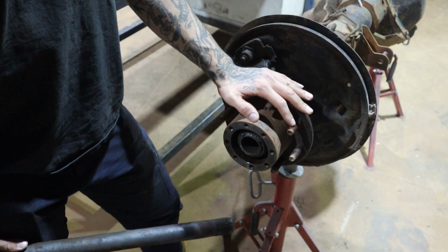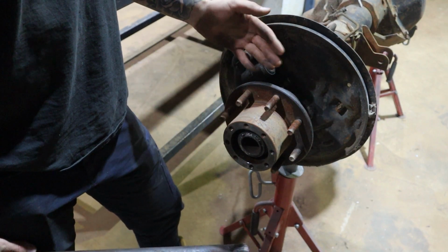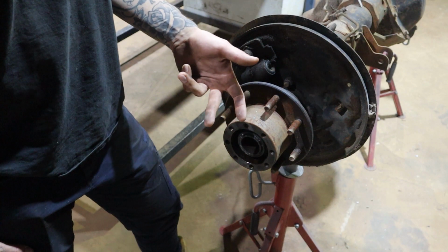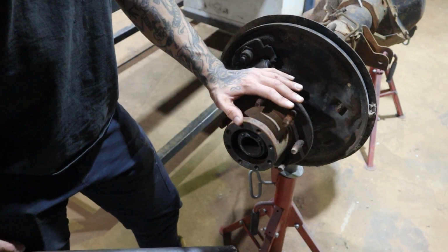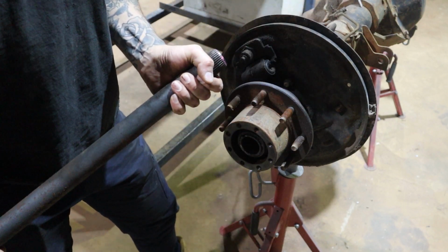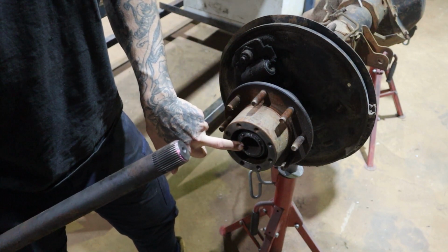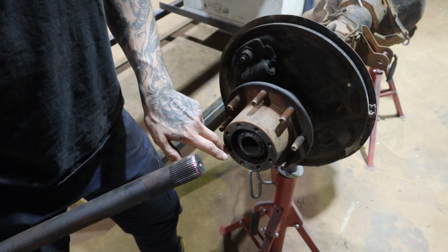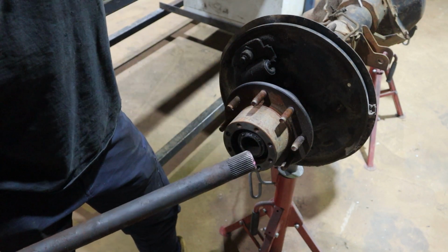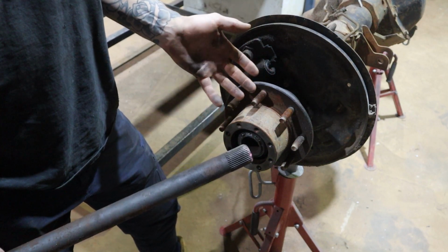Now let's talk full float. What is full float? It's basically an outer spindle which then houses a hub that goes over with inner and outer race bearings, much the same as what you'll run on the front of a Patrol or Land Cruiser. You have a stub axle, your hub goes over it. Benefits of this is weight bearing capabilities and the way you can change the spline of your axles. Depending on your bore, which is different between Danas, you can buy different axle inputs and change your locker inside, your spider gears and your input sleeves, to change your axles purely off doing that.